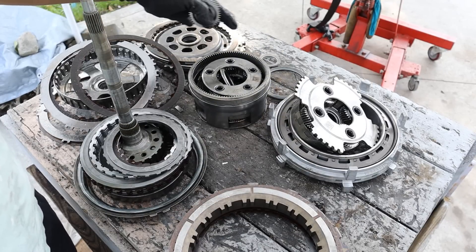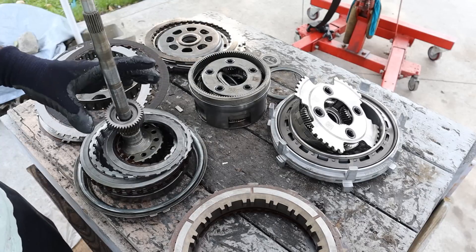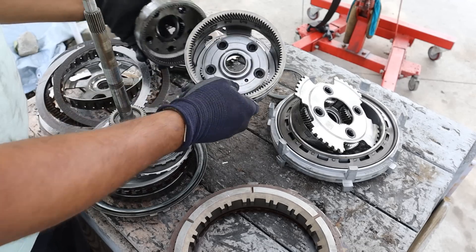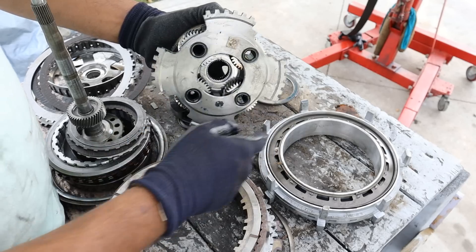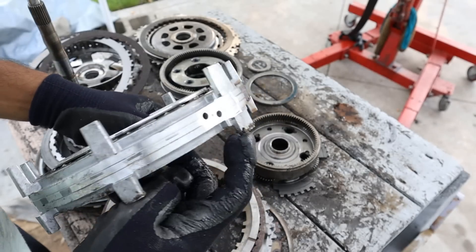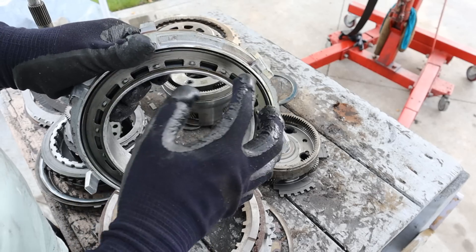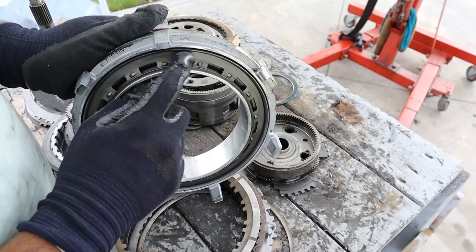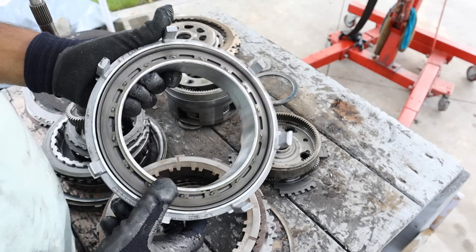If we take a look at the layout of the transmission, we start at the front and kind of work our way to the back. You'll see we've got a first clutch and then the planetary gear set — first thing is the sun gear, which is actually splined to the input shaft over here. We've got a planet carrier, and it's got a ring gear for the next planet carrier which is over here, and that itself also has another ring gear. After that, we've got another planet carrier with an interesting shape on the outside that splines to the clutches, and then we have a ring gear. After all that, we have our piston — fluid can be driven either to the top or bottom pistons, and that's going to cause it to rise up. This ring around here is a piston return ring made of spring steel, and actually in some of these transmissions they were known to snap — that was kind of a weak point. When your piston return snaps, this piston is going to start dragging and remaining in the applied position, and you're going to have all kinds of symptoms like clutches burning up and the transmission slipping.